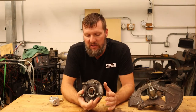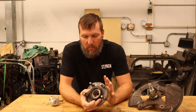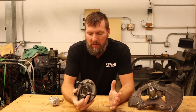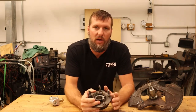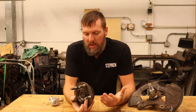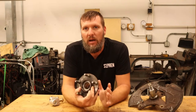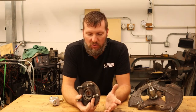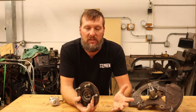The next thing is availability of spare parts. The SN95 hub is a sealed hub so the bearings come with the hub when you buy the whole thing. It's just nice that you can run down to the parts store, buy a whole new hub, everything is set to go, or you can buy it online. It's not a custom part, it's easy to attain. The other thing could be if it has bearings that are easily attained — that is nice also, but I don't want a custom hub that I can only get from one or a few sources that could potentially be out of stock.